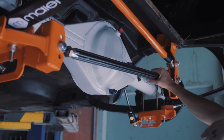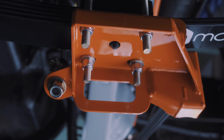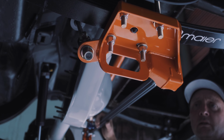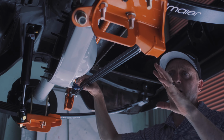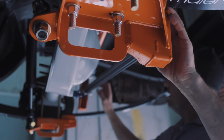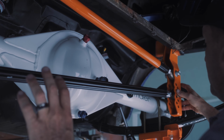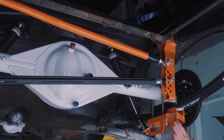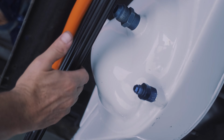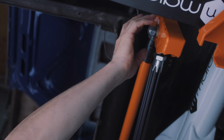So from there, we put in the spring plates, which is part of the panhard rod kit. And if I go over quickly any details, if I skip something, I have an extended video on how to do the panhard rod kit. But I'll tell you basically, the first thing that we did was once we put these two plates in place, we essentially put this cross member bracket, we clamped it up against the frame rail, and we positioned, made sure that the position was right so that it wasn't rubbing against the back side of the housing. So this area here is critical, that you're cleared here. So as long as this bracket provides that line, then you're okay. You can't really move too far here to the right or to the left, and then that's it.